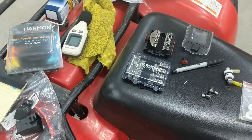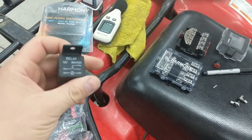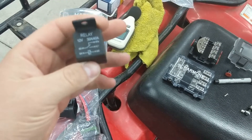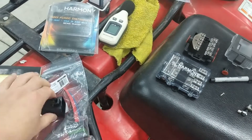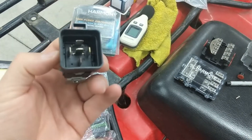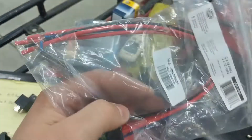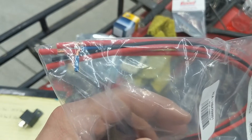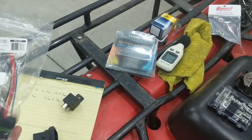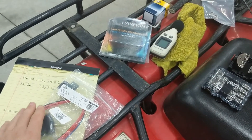I went with the Tyco relay — the same one I used in my Supra. It's a 75-amp. Some cheap ones from the auto parts store are only 30-amp — or labeled 30/40-amp, which I'm not even sure what that means. These weather-tight ones made by Hella are more superior, and they have a special wire harness. The wire on the pigtails is genuinely thick — some cheap pigtails just have thick coating but thin wire inside. I probably would have gone with the Hella if it was just powering one fuel pump, but I went with the Tyco because it also brings power back from my meth tank.